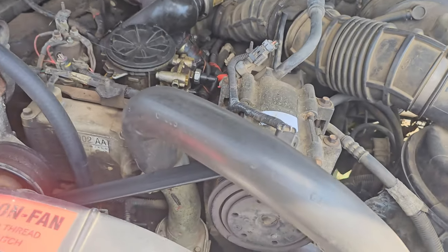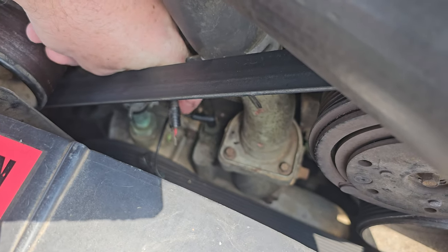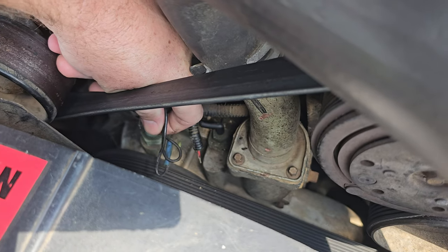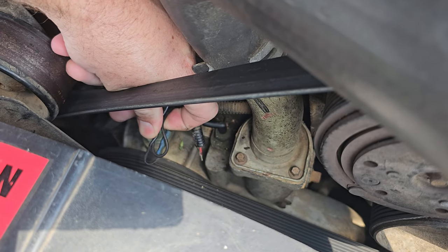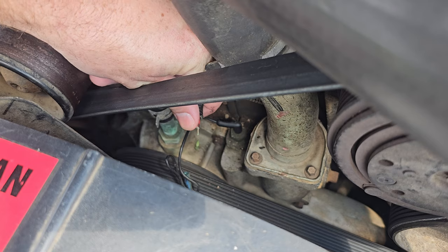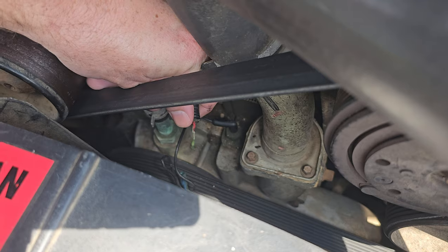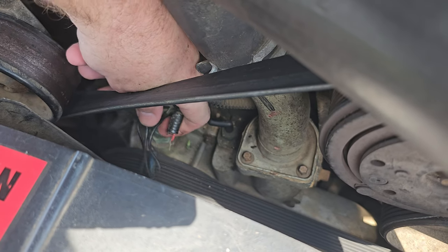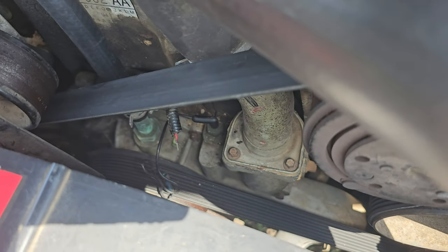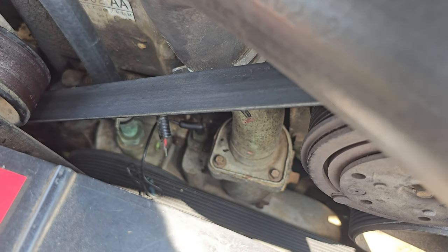I got the hood popped. You can see the bare wire — this is going to the truck. That's the new sensor down there with the wire hanging out here. I had it just crimped regularly together, I think. What I'm going to try to do is pull this cable off, clean that up — you can see there's some corrosion and stuff. I'm probably going to shorten this cable because there is way too much there. Then we'll try to solder them together. It's going to be a rough spot to get to, but I think we can do it.